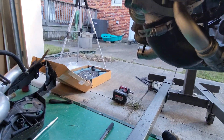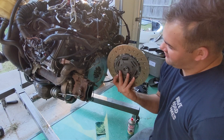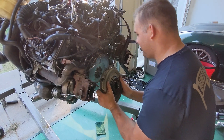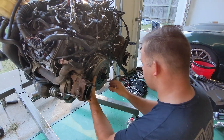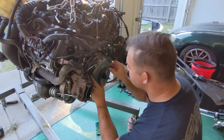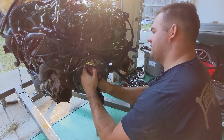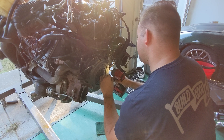Pay attention when you put these things in — you'll see stickers on them that say 'flywheel side' or 'transmission side,' so make sure you orient that correctly or you're going to have all kinds of problems. When tightening the bolts, try to do a little bit at a time all the way around, because this pressure plate is spring loaded and you don't want to load one side of the spring way more than the other and get this thing on crooked.